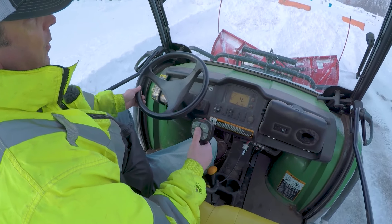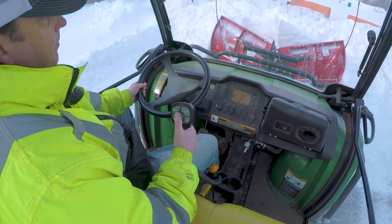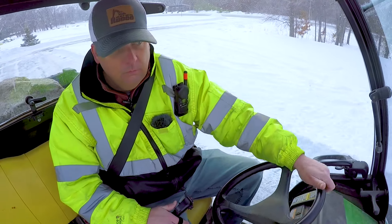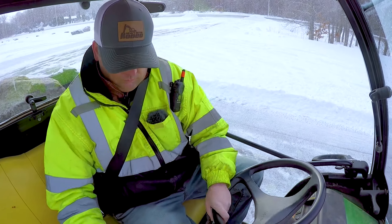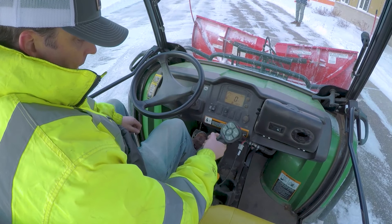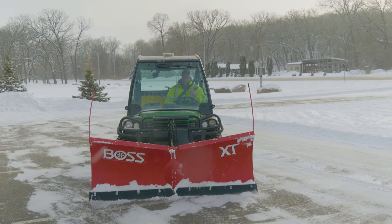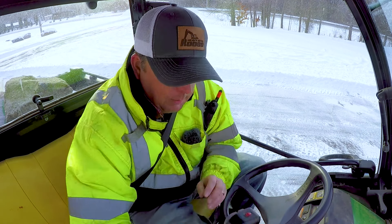This is great for cleanup in the V formation. As I'm raising, I raise it a little and keep pushing in, but you'll notice these won't have near the power of a pickup or any larger piece. When parking, set the plow flat on the ground — with all that weight it's really important. It puts so much pressure and weight on the front axle that you want it flat. Then set the parking brake and shut it off.